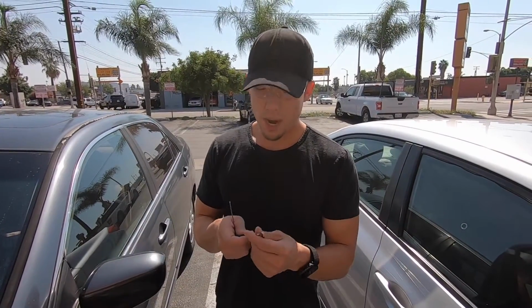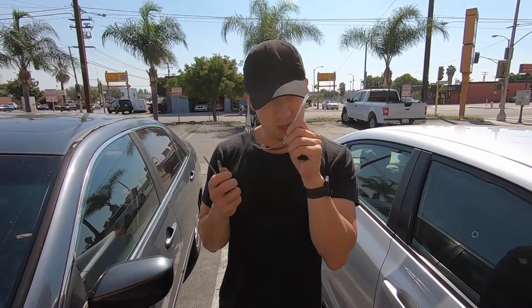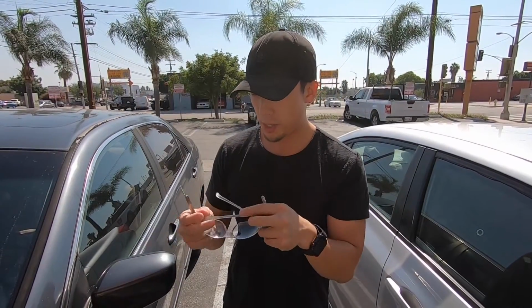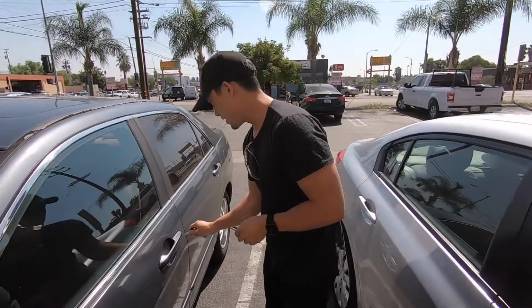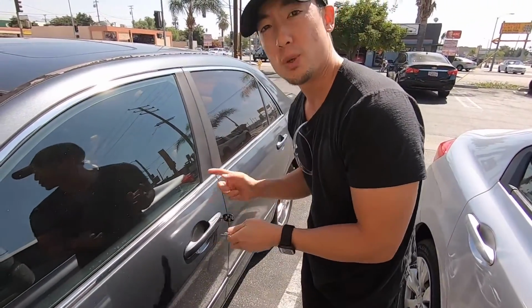Okay, so we're outside right now. I still have my goggles on. What you want to do is make sure you bring out the customer's key as well. Test it first, because a lot of times, because it's worn down, you don't know how it's going to perform. So you want to know, are you cutting a key well? You do that by testing their original key first, because if it doesn't turn, then you didn't mess up. It was the key itself.